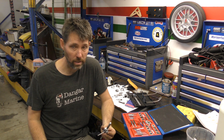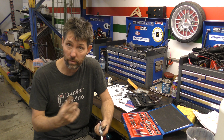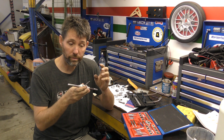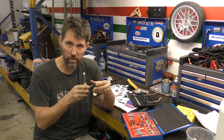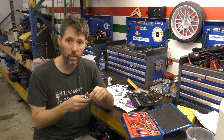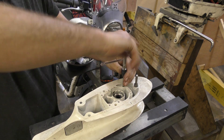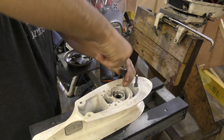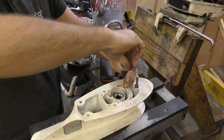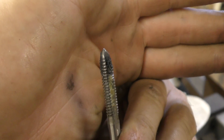I won't focus too much on tapping because chances are you don't need to do this if you're doing a water pump repair. But if the threads are corroded and old, it's always good to clean them out. The basic idea is wind it a little bit in, then back it out. I was taught to put a bit of grease onto the tap — as well as being a lubricant, the debris you clean out will get caught in the grease rather than staying in the thread. Pull it out, wipe the tap clean, and you're good to go. These taps start tapered so they don't do much work until they're a fair way in.